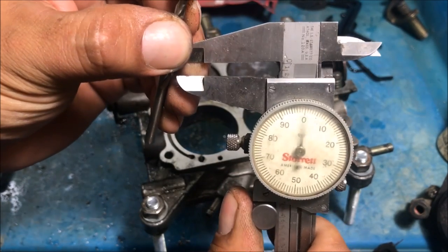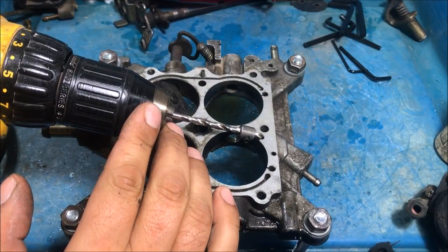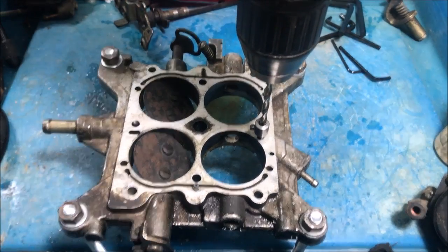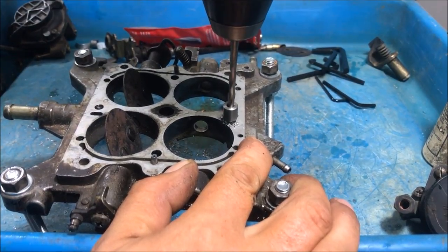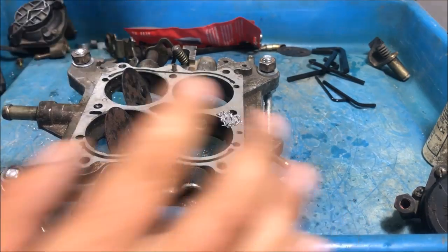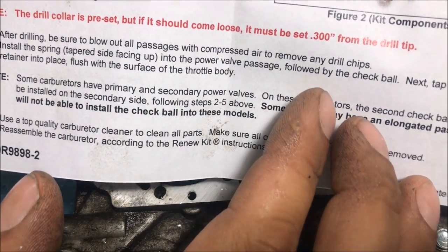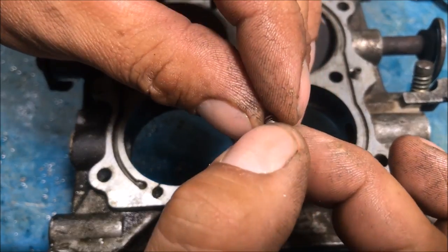We should probably use a drill press but most people don't have one, so we're not going to. The little drill bit stop needs to be set to a depth of 0.3 of an inch — we'll go a little less just to be safe. Make sure you're on the right hole — this one goes straight to manifold vacuum and has a little chamber for the power valve. We're just going to hold this as straight as possible on low speed — I'm the human drill press.